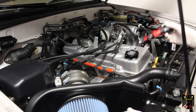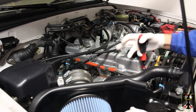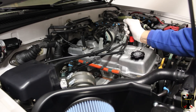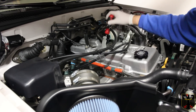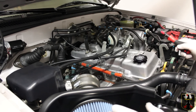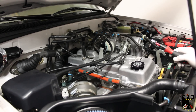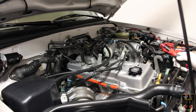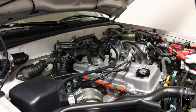These get tightened down to 5.5 Newton meters using a crisscross pattern. I have my torque wrench set to 5.5 Newton meters and I'll start snugging them up going in a crisscross fashion, then tighten them up. Assembly is just basically the reverse of taking it all apart. That's really pretty much all there is to checking the valves. Hopefully this tutorial will help you get your cover off and check things out — and hopefully you'll be as lucky as we are and not have to make any shim adjustments. Thanks for watching.